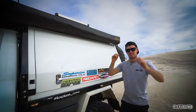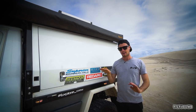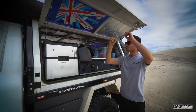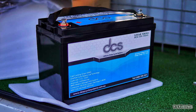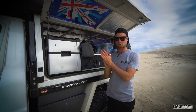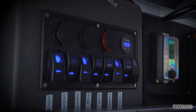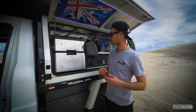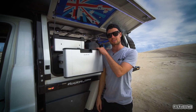The canopy was also made in the backyard using two-millimetre full aluminium — the frame and the skin is all alloy to keep the weight down. Inside: gas struts, lights up here. There's a lithium-ion battery in here — they're really good because you can run them right down to pretty much zero and it will keep its 12 volts. I've got a little power unit up here with switches so I can switch the fridge, the freezer, side lights, interior lights. The fridge is pretty cool — it's a Ridge Ryder but it's got a drawer so I can access stuff quite easily without using a fridge slide.